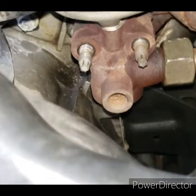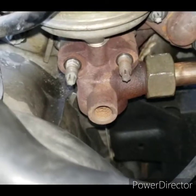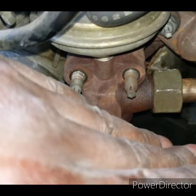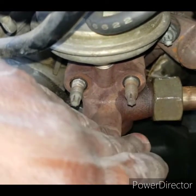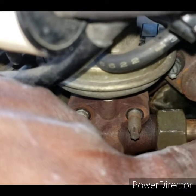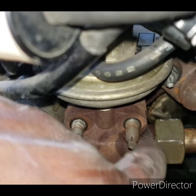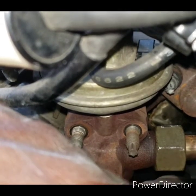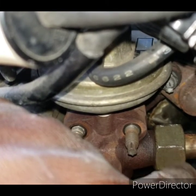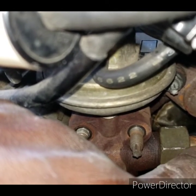Okay, so basically I had to take those two bolts back off until I dealt with that hard exhaust line right there. Do that first because everything is free and wiggling, and you could use both hands up under there, prop both ends up, and push them together. If that bolts up evenly, like it screws on the threads easily, you're good as golden. It screws all the way on, no binding. Unless that's the way you took yours off. But the same way you took it off, the same way you put it back on. Nothing binding, nothing cross-threading. If it's catching a little too harsh, stop, take it off, try again.